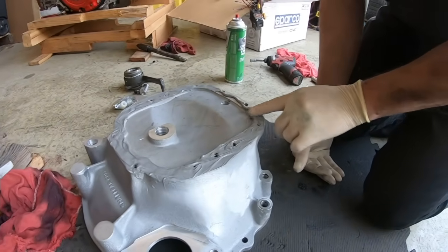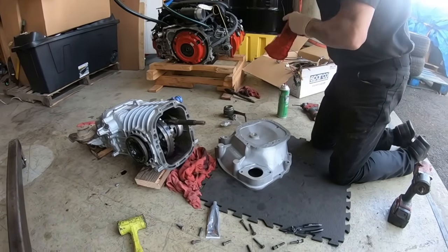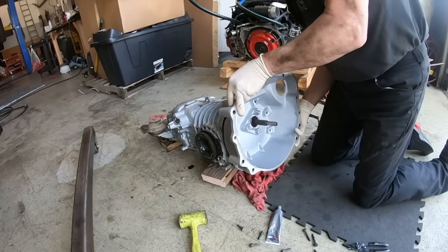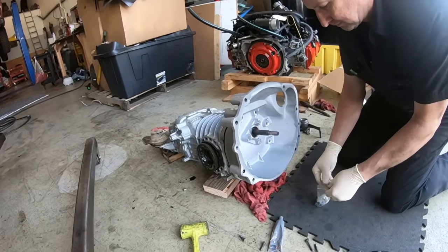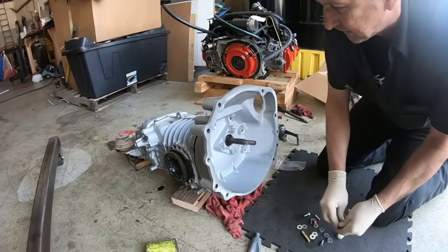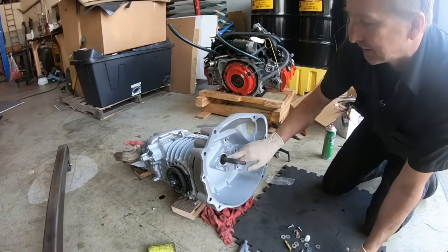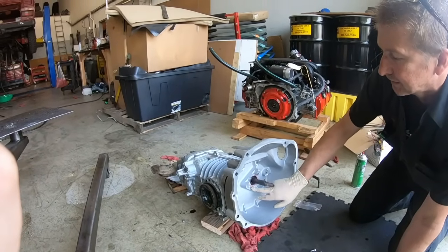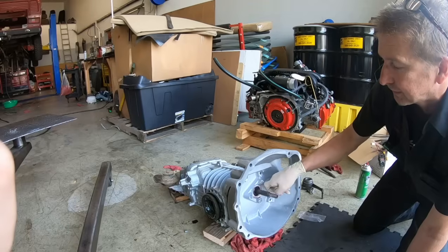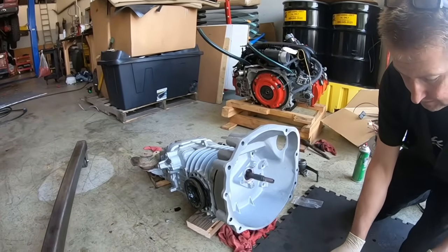Close-up there — George is really working it. One thing that we skipped is putting in this gasket. Take your rubber input shaft seal; put grease on the outside edge of the seal to make it go inside the bell housing better. Get a socket or whatever size fits over the top of it best and pound it in until it stops. Do this on the ground before you put it on the transmission. Make sure your seal has a good seal and that you don't have any folds or it's crooked — you will have issues if that seal is not flush, flat, and tight in there.